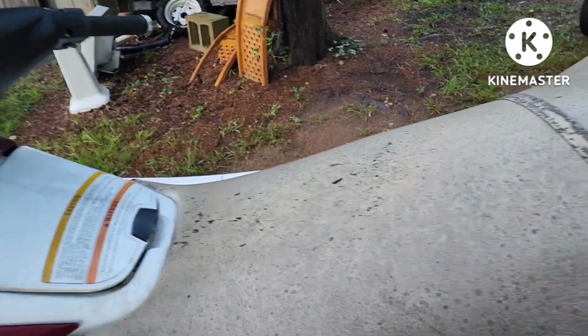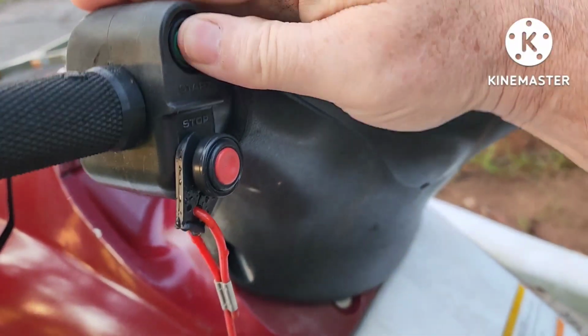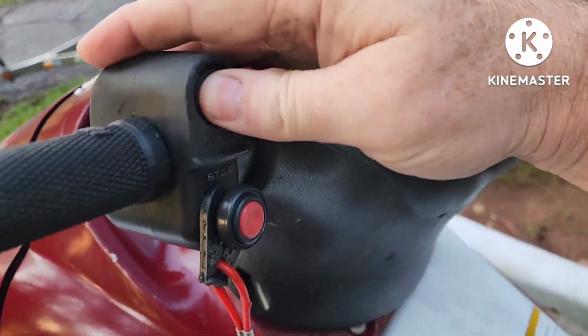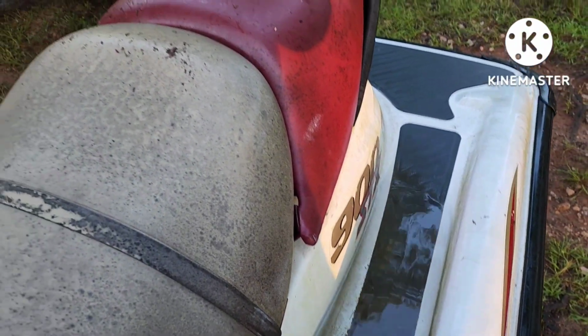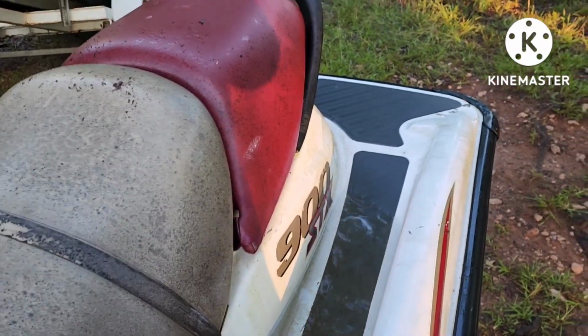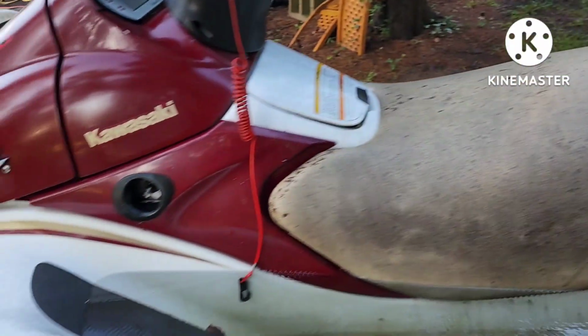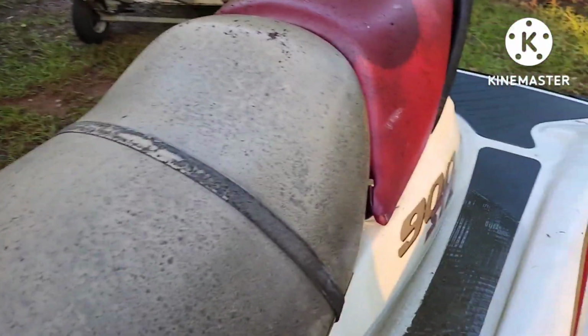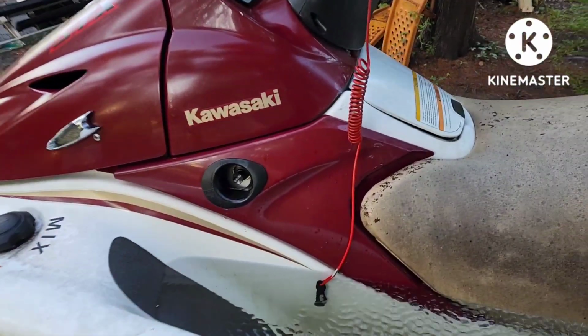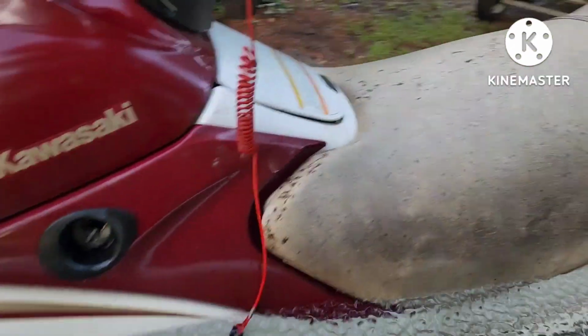This thing works now. Well, I gotta get some gas, I guess. It's cold. It doesn't have a choke on it still. All that's left to do is to take it on a test run. Running premix. I didn't put the new velocity stacks on it. This guy wanted to go cheap as possible because he just wants to sell it. So it'll crank. You've got to use the primer to start it because there's no choke plates. But this one's ready to go.